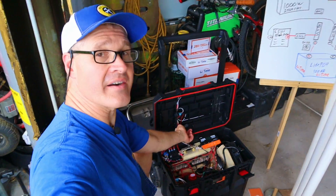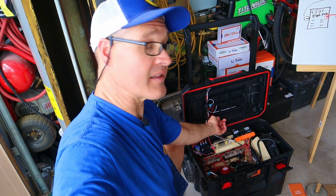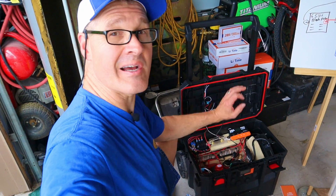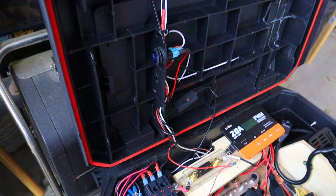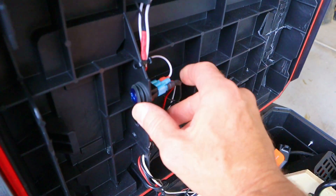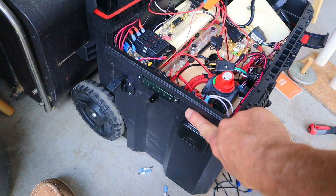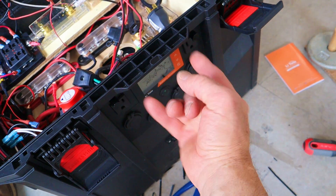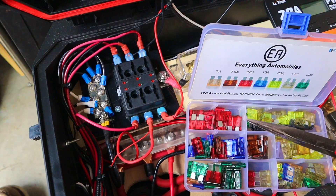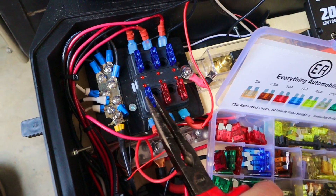I've wired in my cooling fan with my LED lights and it has manual off, high, and low settings. I plan on wiring up a thermostat later. I've got two circuits left for the LED lights. I have three switches: one for lights on the inside of the box, one for the bright LEDs on the outside, and one for the license plate lights to illuminate the power ports. I'm using 10 amp fuses for the LED lights and 15 amp for the other circuits.